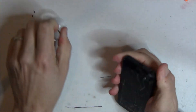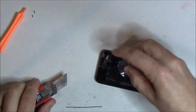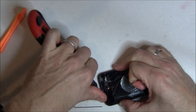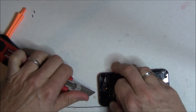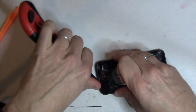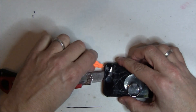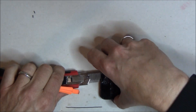Next, we're going to go to the suction cup and you can pull on it. If you've ever taken apart an iPhone 3GS, this is much tighter tolerance. In a lot of cases, what you're going to need to do is get in here with a straight edge razor blade or a spudger, being careful not to damage the lip around the phone. I use one hand to pull up and the other hand to try and get underneath, between the edge of the screen and the bezel. It is a very difficult thing to do. When the screen is only broken a little bit, that large orange suction cup works great. In this case, you've just got to kind of work and go real slow, otherwise you will ding up that edge. I pop it up a little ways and then use the orange spudger to kind of go around and release it a little bit more to where I can get my fingers underneath it.